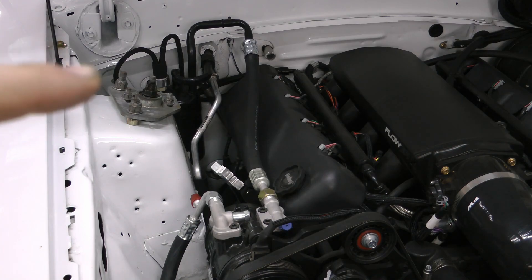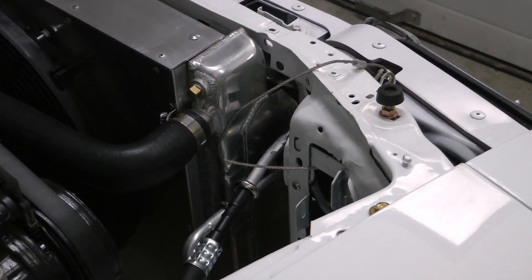For the AC wiring: I have a pressure switch with wiring going to the compressor. In general, there's one wire that turns the AC on when you activate your heater controls. You then run it through two Bosch relays. The first relay is triggered by a ground output from the Holley, which cuts power to the compressor at high RPM. The second ensures the electric fans come on when AC is on. The third feature is the IAC kick — the car increases idle when AC is engaged. All three features wire in using just two relays.